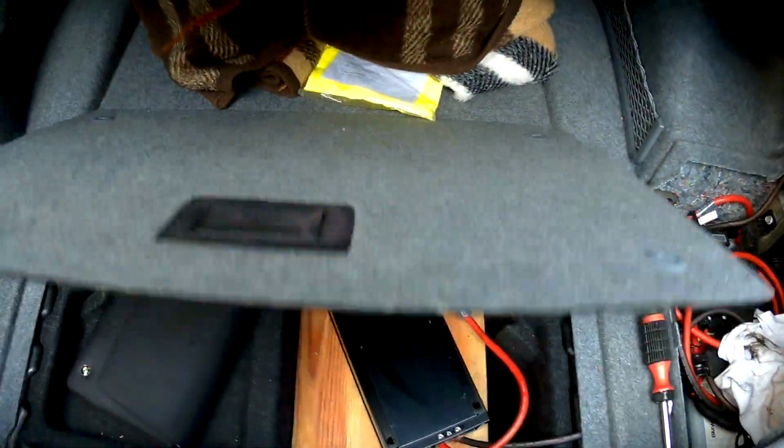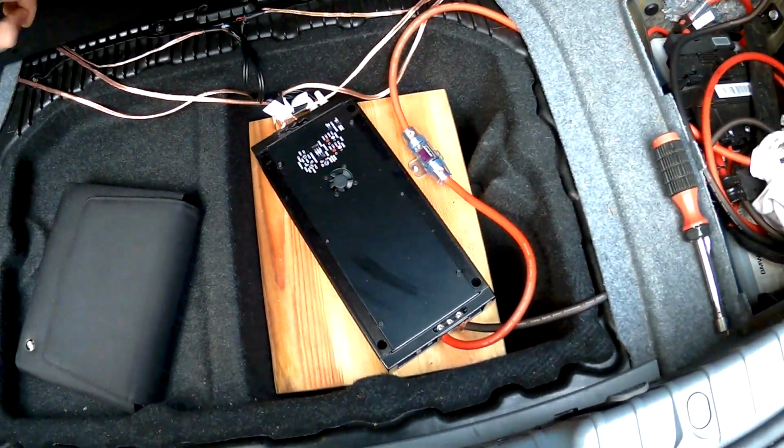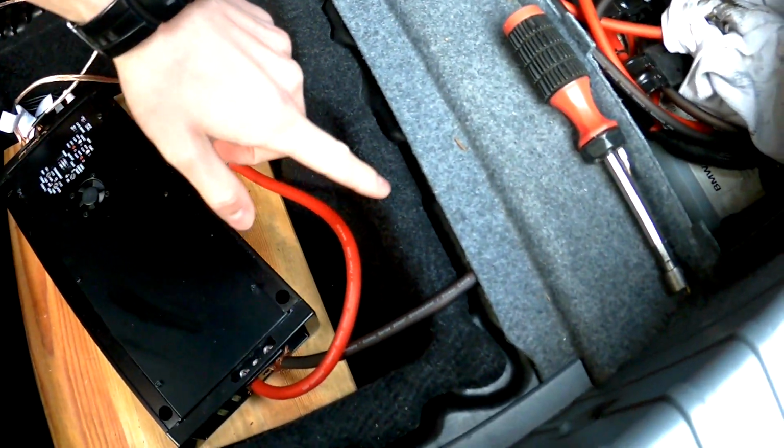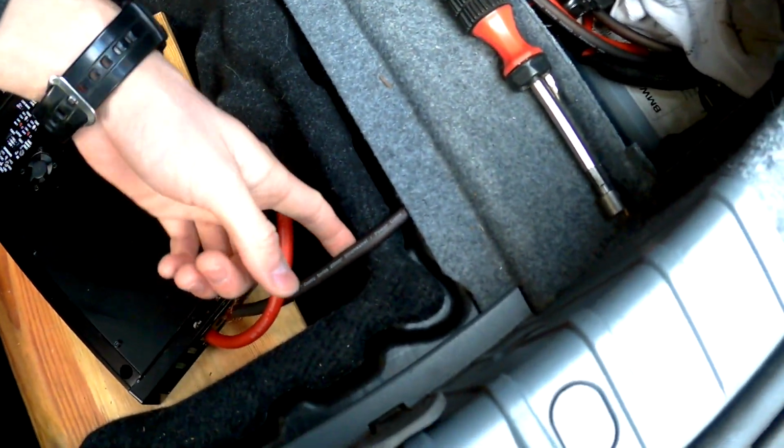What you can see underneath here in the spare tire area, I've already placed the amplifier, having the plus pole from the battery and the minus pole, which is cabled beneath here. There's a big thing where you can put it on. I'll put a picture in the description. Believe me, it's the best thing to do, because spots or screws like this one on the rear light don't work because the paint underneath is too thick.